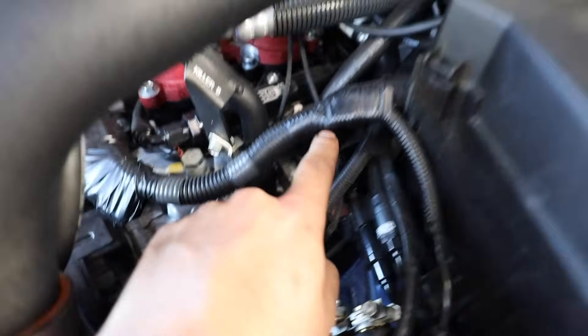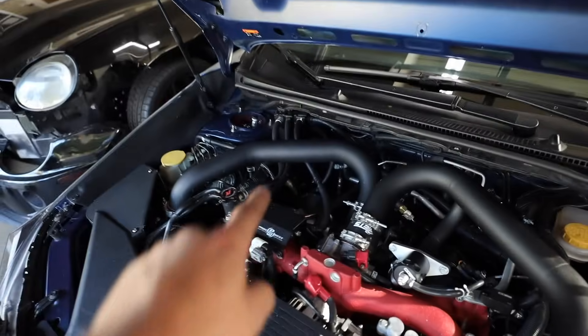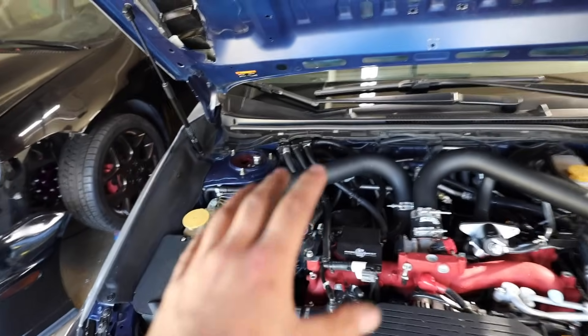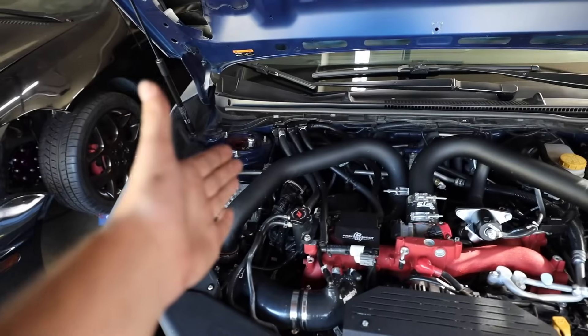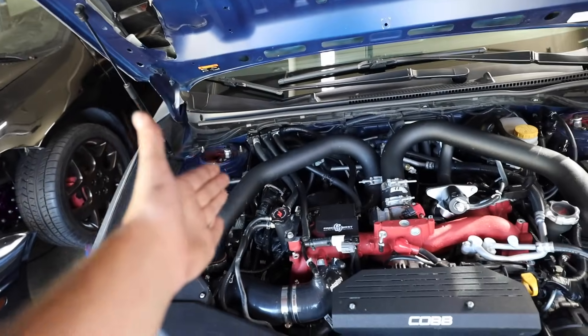Off the head there's a ventilation port, and that port wraps around and goes up to the air oil separator, where it helps balance out some of that pressure before getting it back into the system. Now I want to show you the inside of this air oil separator.